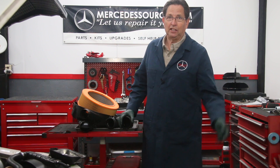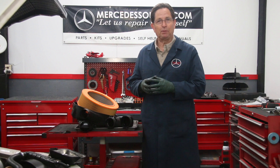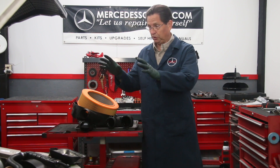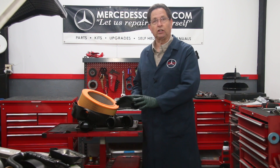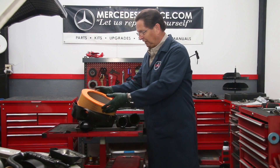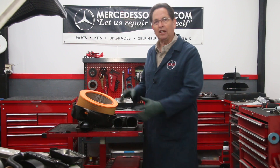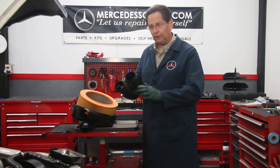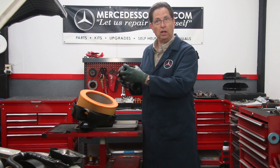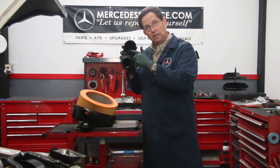You might think I'm making too big a deal out of this, but I've opened up enough of these diesel engines where the whole engine is in pretty good condition except the cylinder walls and piston rings. So you need to make sure you're doing religious oil changes and that there are no air leaks in and around the air filter housing. You may think a brand new filter means no problem — not so. You can't believe how many air filter housings I've pulled off these engines only to find the top seal has been pushed back, the clamp tightened down, and there is no seal — air is being sucked right through this edge of the housing.